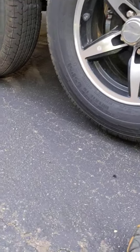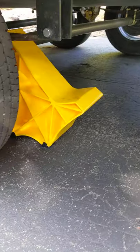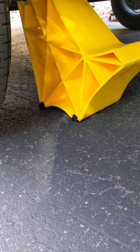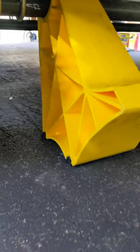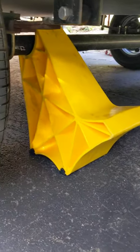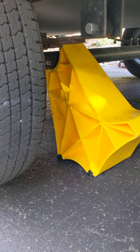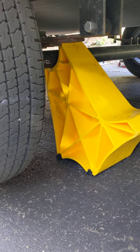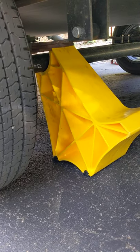I'm on blacktop. I have seen where you can put a rubber pad underneath these to spread the weight, or a two-by-six underneath there. They are beefy and highly recommended — much easier than using a bottle jack. They're rated for some ungodly amount — I'll put it in the comments. That's my review of the trailer legs: highly recommend them.